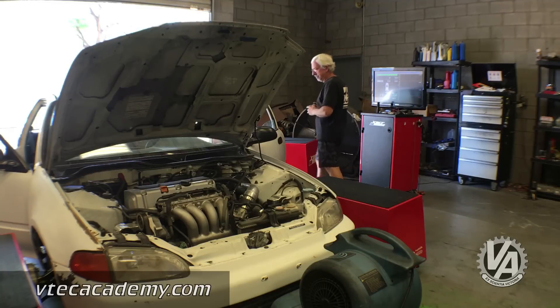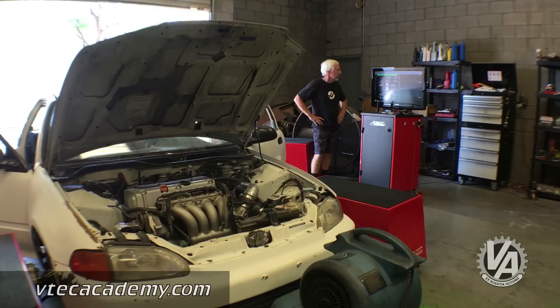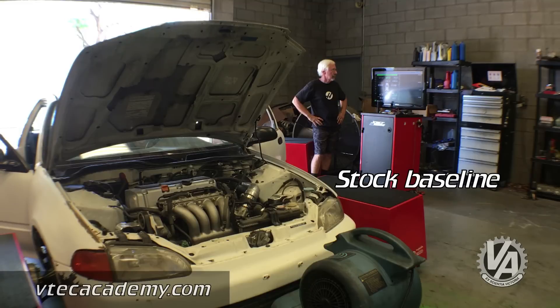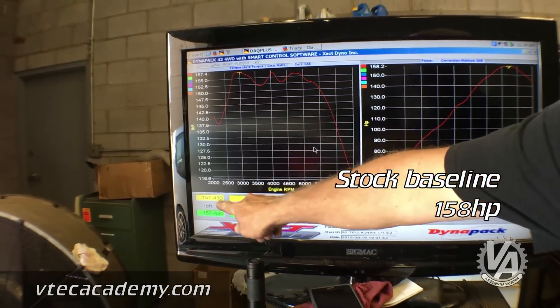I'm kind of curious to see what it makes on the base tune. James, you've actually tuned one of these before — your dealer Turbo Jitter Tuning tuned one in Florida, up 12 to 13 horsepower on an Accord. Our results may vary since this is Arizona in June — about 115 degrees today — and we also have a catalytic converter on here because I want to get through emissions. Anyway, we dynoed it and got 158 horsepower with 157 foot-pounds of torque.